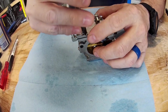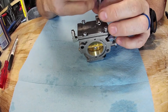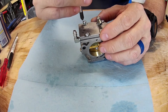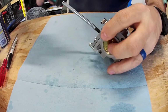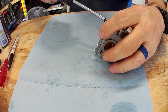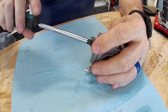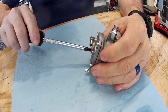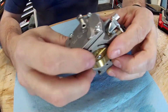That being said, the next year when I replace it or rebuild it, I make myself a little jar with gas, or usually with my carb cleaner in there, and I soak the screws and the two end cases with it. I let them soak while I'm cleaning the rest of the carb, and then I can wipe off, maybe with a green scrub pad a little bit. I can get the old torque check off, and then once it's all dry and back together and good, I can put a new dab of torque check on each of the screws, and that lets me see if any of my screws are coming loose without having to retorque stuff, which can wear out the holes and the threads over time and cause you to lose screws.